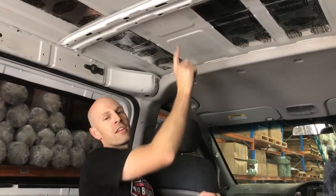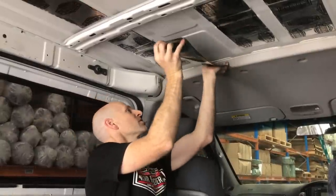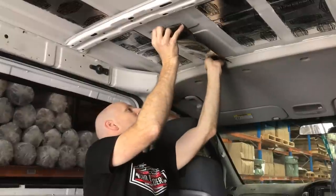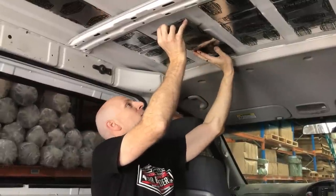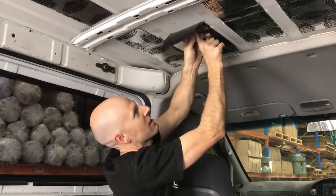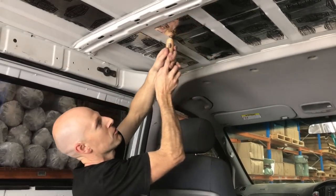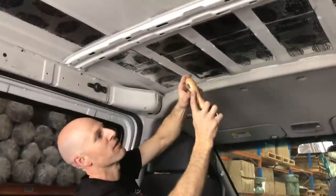So here's a little tip for you. When you're doing areas like this, which are going to absorb some length, we're going to stick this up on the left end here. And rather than bridge it across, then try and push it in and stretch the material, I'm going to roll it down and then push it in with my fingers, roll it up and then push it in again, and then put that down. You can use the end of your roller here to push it in there, and even this domed end, you'll find uses for it.